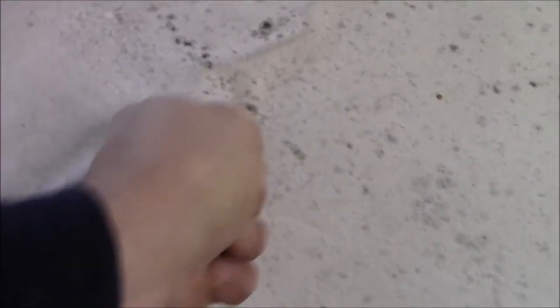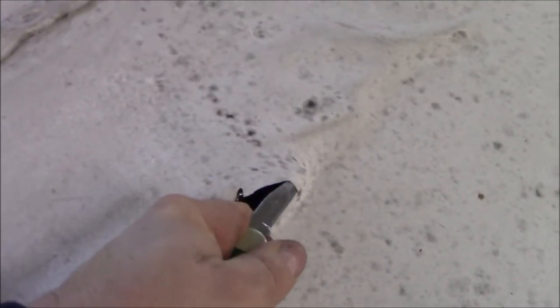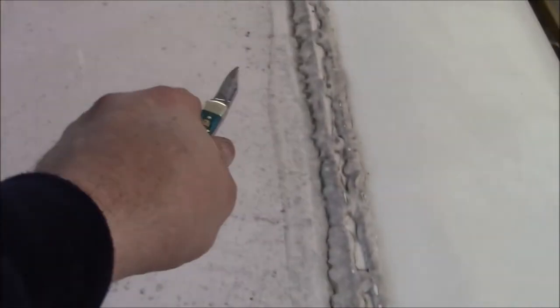A couple of things I noticed on some other coaches - some folks have sent me pictures. This moisture underneath there, that's plywood sticking up. We're going to try to get that transition better, make it look professional. There's a lot of water slamming up against there, so we're going to try to smooth that out so the water will flow off.